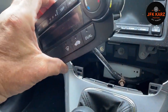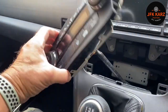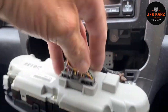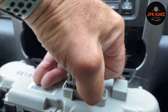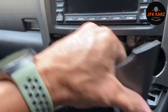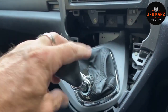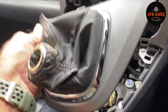It's an old car, so that's out of the way. It's probably going to be better to just disconnect it — there's only one little cable on the back. You can just see it — push that tab forward and hopefully that'll come out. Yeah, there you go. That was easy. So it just lifts up. Now unscrew the gear knob and we can see what we've got to do underneath.